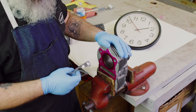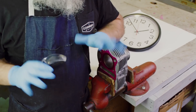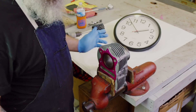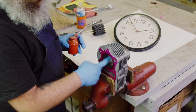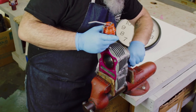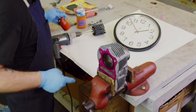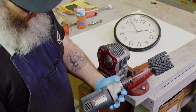Okay, we're set up to do the hone now. I've got the cylinder mounted in the vise so it's not going to move — horizontal is nice, but it makes a mess. Gloves on, apron on, safety glasses — because this stuff is going to get flung everywhere when we actually do the honing. Cut our clock out so we can keep things timed. I just put some oil on the cylinder and work it around; I want a nice even coat of oil inside the cylinder. Here's our hone set up on the drill.